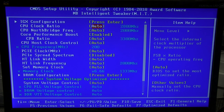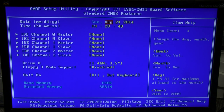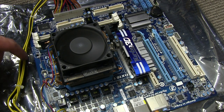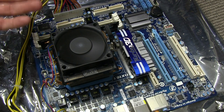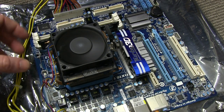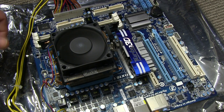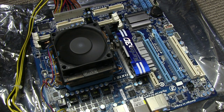2.8 gig it looks like. It's all looking very, very good. I've penned in some decent burning tests and stuff like that. It didn't come with any memory this time, but I just whacked a single 4 gig stick in there and it's working just fine — 4 gig of DDR3. It is a DDR3 motherboard. Same benchmark as those i7s I got before, except in the AMD family. It is 6 core, it's got HDMI, DVI output, integrated graphics — very handy. We've got PCI Express expansion slots, and 6 gig SATA, USB 3. What a winner. Too bad I don't have a micro ATX case for it though — it was just the bare motherboard.